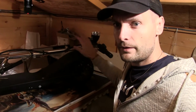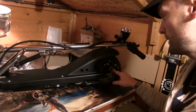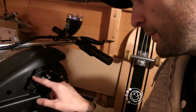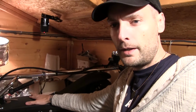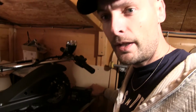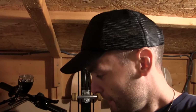This is our scooter. What we've done is we fitted a light, sprayed the wheel, we've fitted this brake caliper. Can you see this here? We've fitted obviously the brake disc, brake caliper, changed the brake cable. Everything works. If you pull that, it squeezes a disc, which is awesome. Changed the battery pack, so we've got rid of the traditional 12 volt acid filled batteries, and we've gone for the lithium 36 volt batteries. Changed the motor and sprayed it up, and I am happy with what we've done.